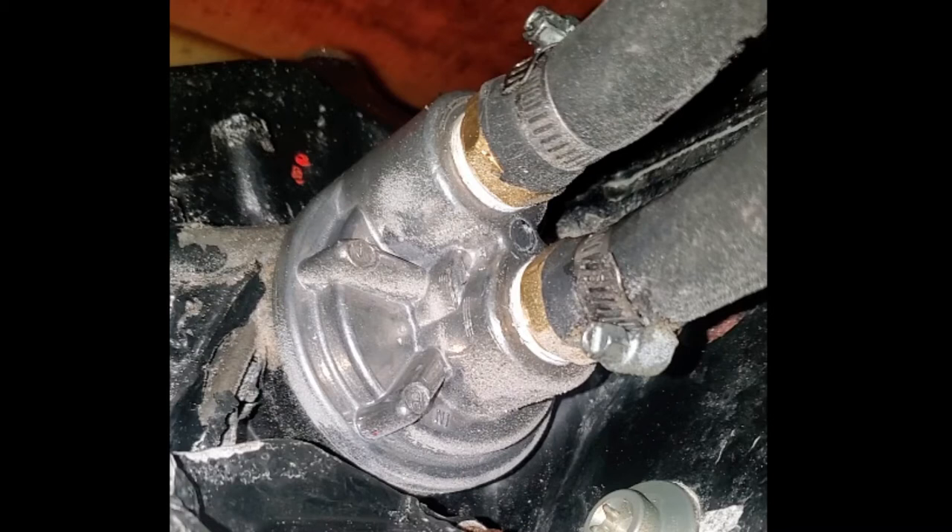Make sure it's tight there on the bottom, and then at that point run the hoses out of that oil filter housing. Those hoses will run up along the side of the exhaust. You should zip tie them safely clear of the gear shift area and then run them up along the back. Wherever it's going to touch the exhaust, the company says this kit will withstand the temperature, but I went ahead and got some Permacool insulation sleeves to put over the hoses and use little wire ties to secure them in place, just to make sure you don't damage those. The last thing you want is to lose oil pressure when you're out in the middle of the ocean.